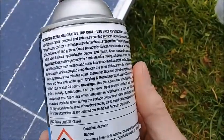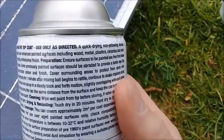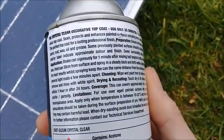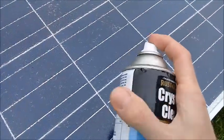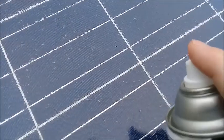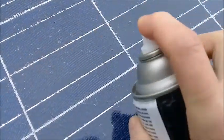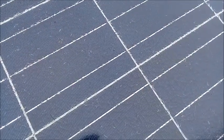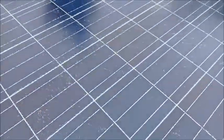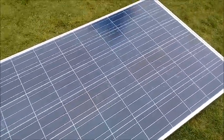Face mask, gloves, and not a windy day — then got spraying. Quite happy with that result so far. Obviously the cracks are all there, but when panels shatter they bend slightly and lose all their strength. It's a bit like laminate really — the glass is stuck onto the panel. Spraying it all again strengthens the panel; it's gone stiff and you don't get splinters coming out. You need to wear gloves when you handle shattered panels because although the big bits hold on, you get little splinters coming off.